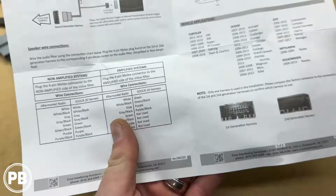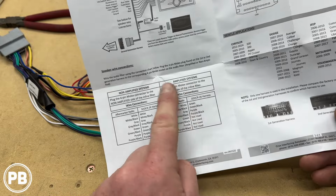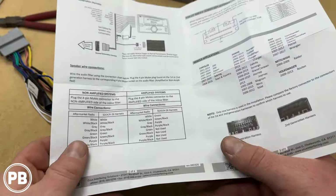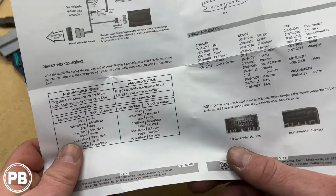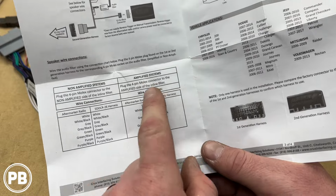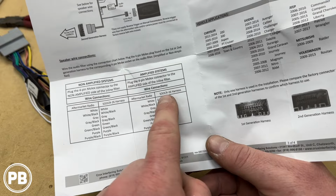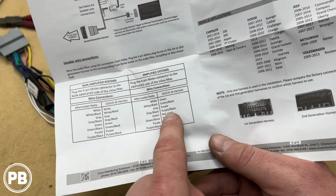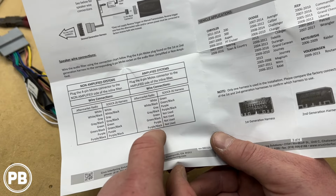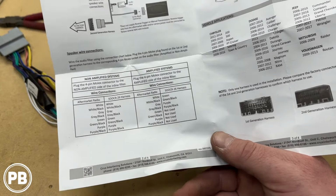Now, this is going to make a lot more sense if you take a look at your instructions here. If you have the non-amplified or the amplified system, it basically diagrams how to make those wiring connections. We go over this manual in greater detail here on the channel, so if you want to see that video in action, we'll link it in the description. Just as a quick summary, if you have a factory amplifier, you're going to wire your aftermarket radio's white, white-black, gray, gray-black to the Crux harness's green, green-black, purple, purple-black, respectively. On your radio harness, you won't use those greens and purples. And on your Crux harness, you won't use the whites or the grays. Those will just be unused.